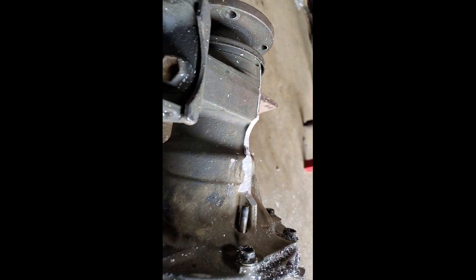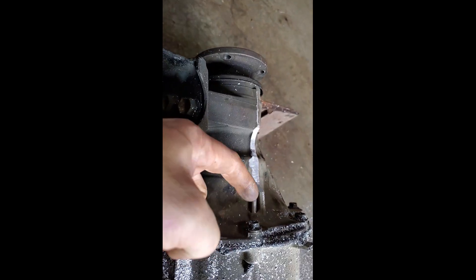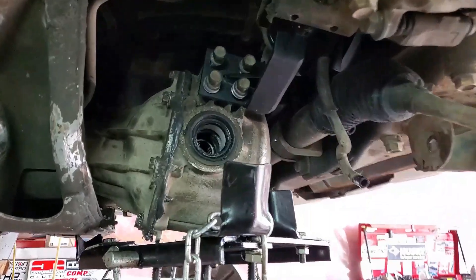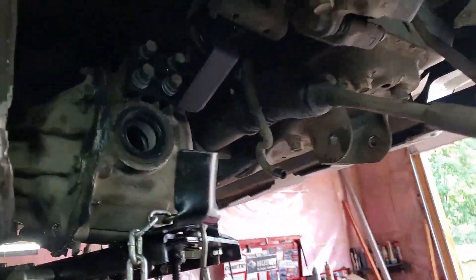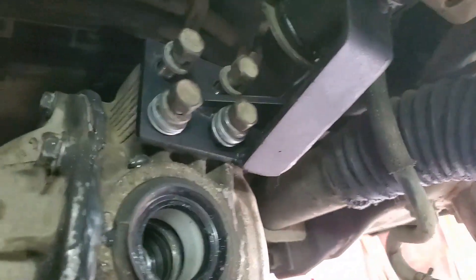I clearanced it quite a bit and I think I got it in the right place. I didn't take it all the way back because I'm not sure how close it needs to go this way, so I'm gonna try that and see how it fits. It's mostly in and it was fairly easy to get in there. If you don't have a two-post car hoist, I recommend having one for this job. A transmission jack also makes it really easy because you can hold it in a different place and get your bolts all started. I got that side done and the hanger is in.